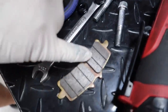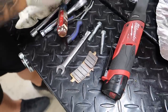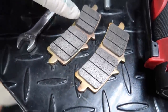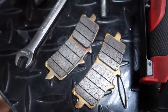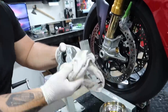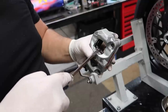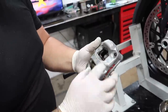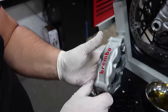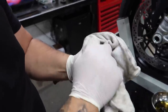Try to keep the brake fluid away from the actual pad surface. The pad material — I believe they use ceramics for these, Triple H compound for race applications. If it's metallic you'll see little metallic pieces in it. Notice how it looks like it's cracked — on your supercars, the carbon ceramics look like they're all cracked up. So that's the front brake calipers off. I'm going to take this retainer clip right off — once you bend these even a little bit, you've got to bend them back before you reassemble. I'm going to give him the calipers and keep this rubber thing on — let him do his magic on painting. People wanted to see different stuff; this is stuff we've never done before. If you're a true enthusiast and you enjoy this type of content, you're on the right channel.